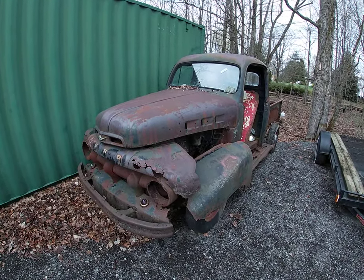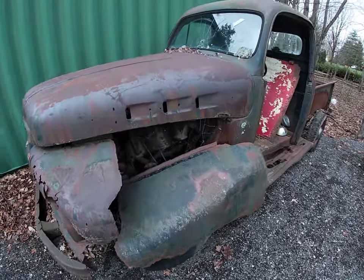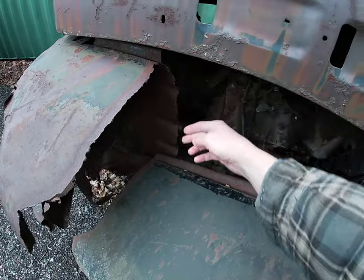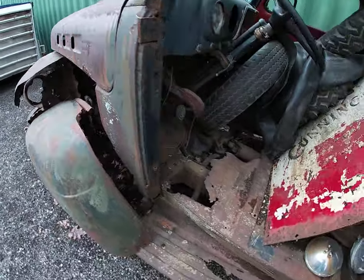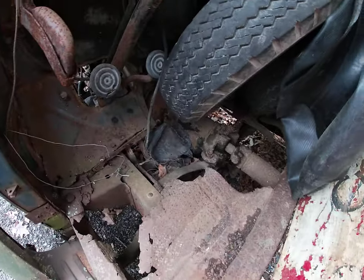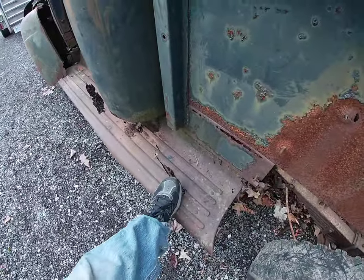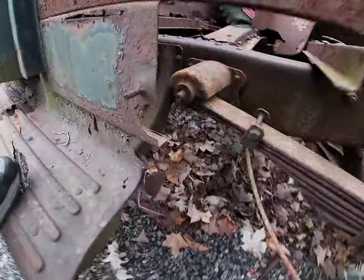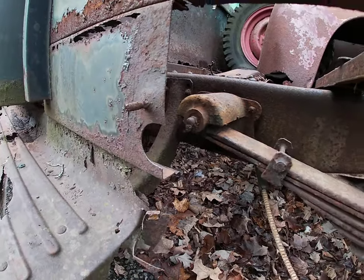For everyone who said this should be restored — you can fix everything, sort of. The fenders are always bad on these; these ones are torch-cut off. The inner fenders are torched out, the hood's rotten, the cab is pretty rusty. Running boards are rotten, and this flexing here isn't the running board — it's the frame. The frame is rusted out right there, with pieces falling out, and the whole spring mounts are going to come right off.